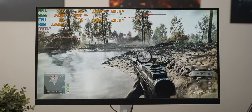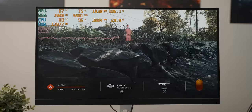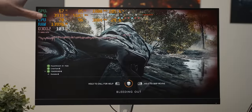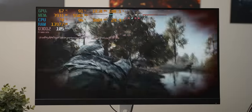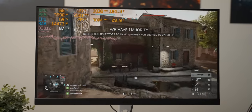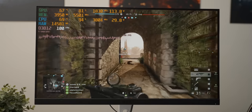With Battlefield 5, the problem is not quite as bad. We're still getting a little bit of a CPU bottleneck, but occasionally we get up to about 90% GPU utilization, so it's not like the graphics card is being maced in the face. After playing for about half an hour, the temperatures are very impressive for a little thing like this — nothing like the standard gaming laptop cosplaying as the surface of Venus. And the noise isn't bad either. I was kind of expecting the SR-71 at takeoff effect of a gaming laptop, but it's not doing that.